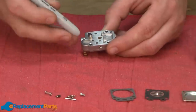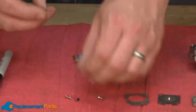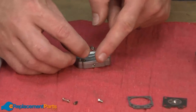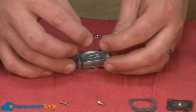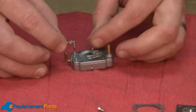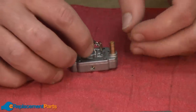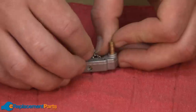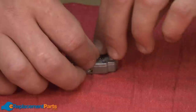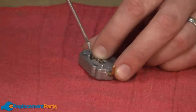It seems to be just the perfect size for those screens. On the other side of the metering base, I can go ahead and put together the metering needle assembly. I'll place the hinge pin into the lever, place the needle on the end of the lever, set the spring into the base, and then drop this assembly down into the base, and then secure it with the screw.